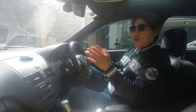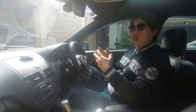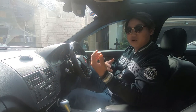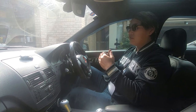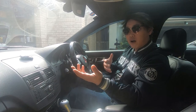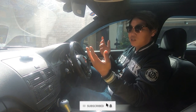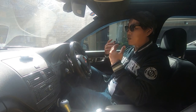It does not reset your ECU in any way. However, there are some pros to doing this reset. If you're not happy with the way your car responds according to your driving style, or you bought the car off somebody else and their driving style is a lot harder than yours and you notice the shift patterns are extremely long — meaning they hold gears for longer — then doing this reset is going to give your car a chance to learn the way you drive, thereby saving fuel, shifting smoother. Or if you don't like the way the car responds because it feels laggy or slow, then doing this procedure will give you a chance to drive your car hard and make it feel like a sports car again.